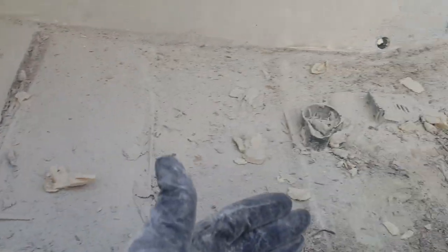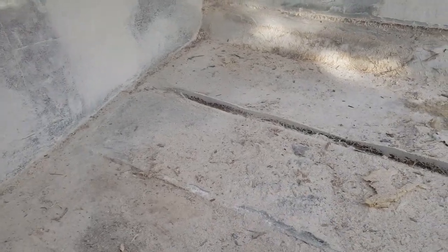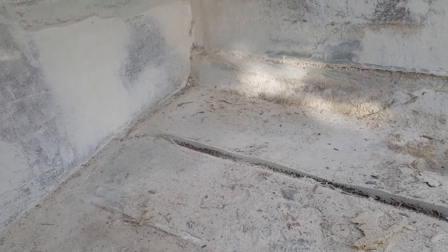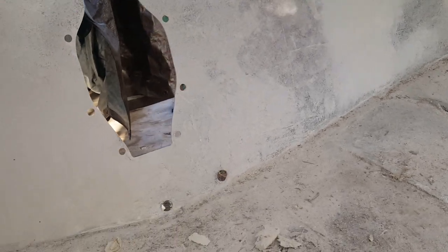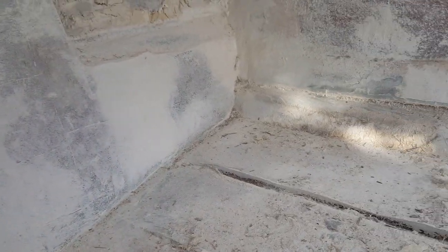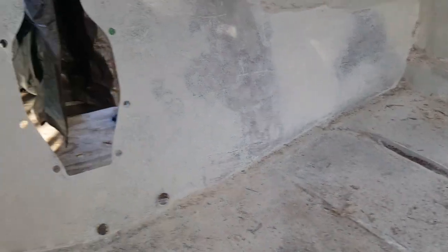Because it's so dusty inside the transom area, I'll work just up to a certain point and then do these two stringers, all the way to the other two on the other side. It does get annoying after a while — you have to carry a rag and dust off your mask probably every 30 seconds. I'll finish grinding this stringer, this little one, and then this last one, not forgetting where the floor goes.